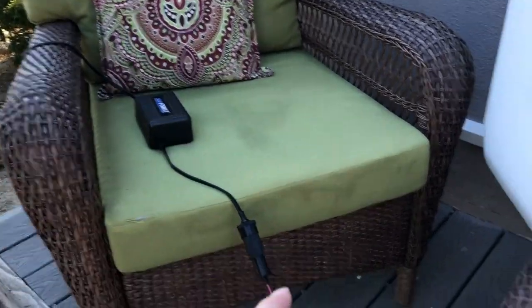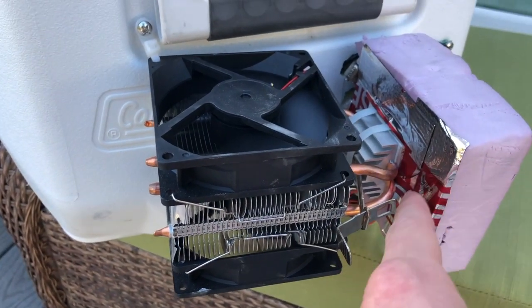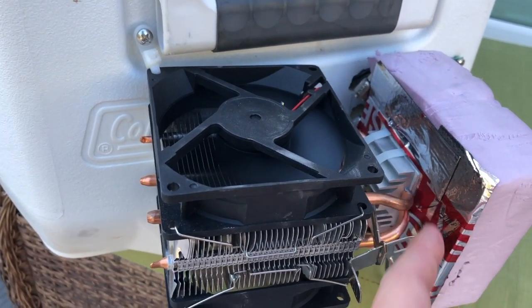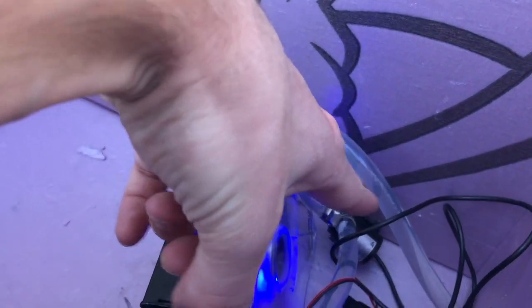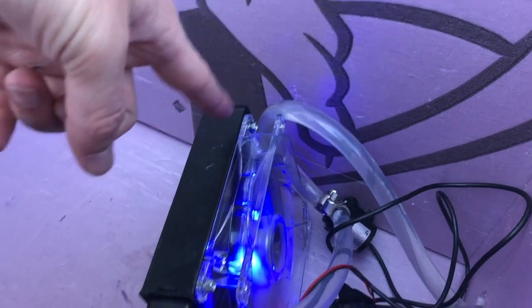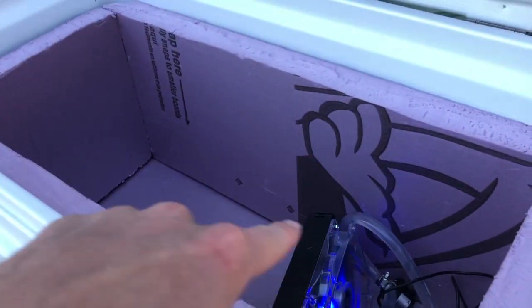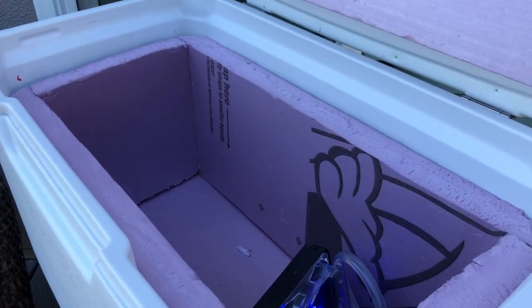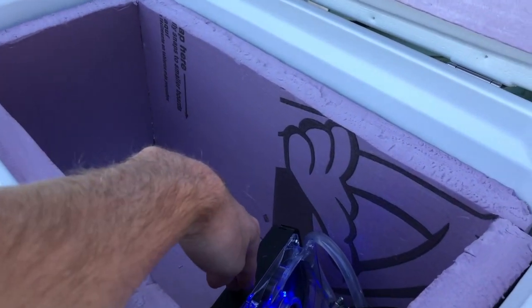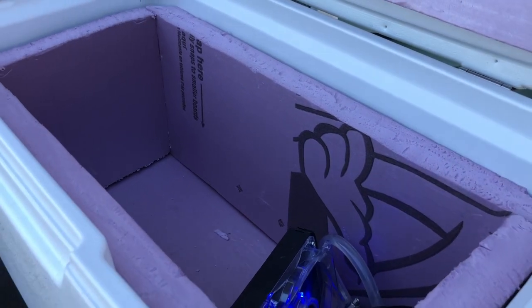We're going from the 12-volt system all the way in. I just turned it on — the heat exchanger, the thermoelectric device, and the little cooler inside are all running, getting the liquid cold, with the pump moving all the water through. The pump is moving the cold water into the radiator and the fan is blowing it through, circulating it all the way. I also added insulation all the way around to increase the R-value so the system doesn't have to cool as often or as hard.